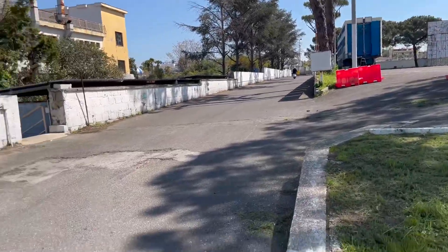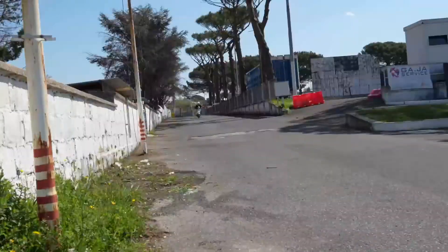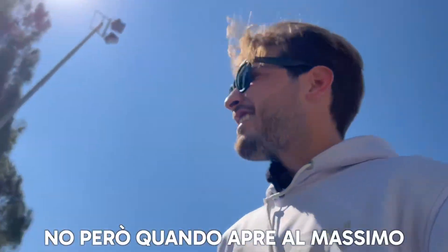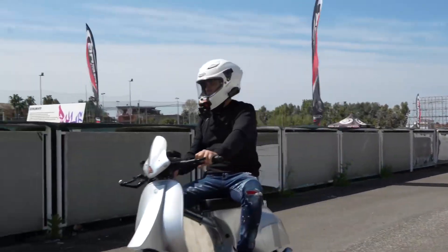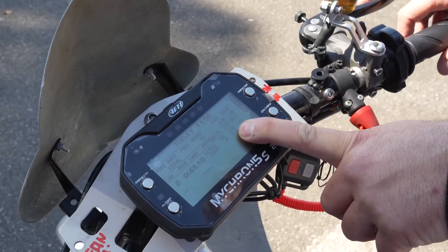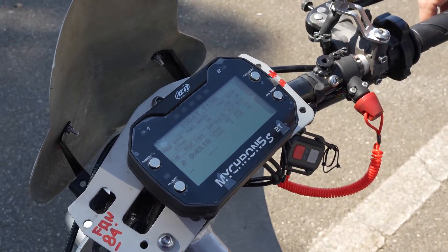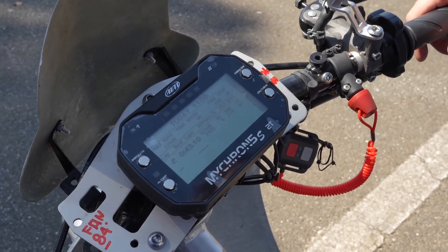The problem is that he has to brake, but he takes 100 km/h in about two seconds. Ridiculous. When you open it to the max — spectacular, guys. The two-stroke is spectacular. We don't put it on the bench because I'm skeptical. We recorded 12,946 revolutions, 99 kilometers per hour, but with an exhaust temperature of 450 degrees. This means we are still running rich. We leave it this way to protect the cylinder. We're talking about 100 kilometers per hour in roughly 70-80 meters — about 262 feet. Spectacular.